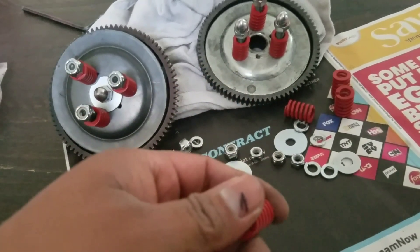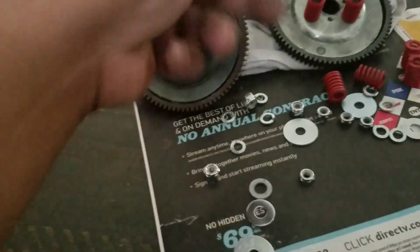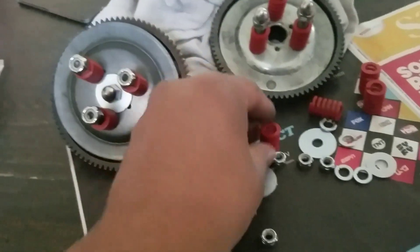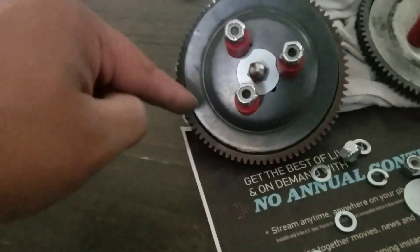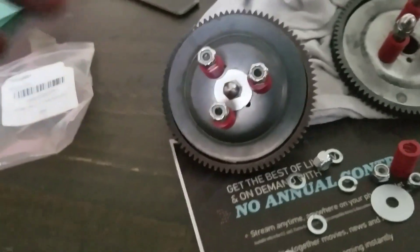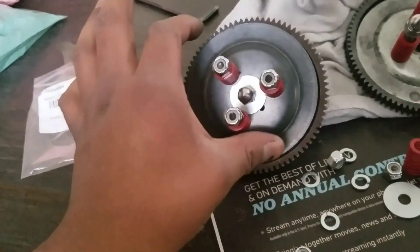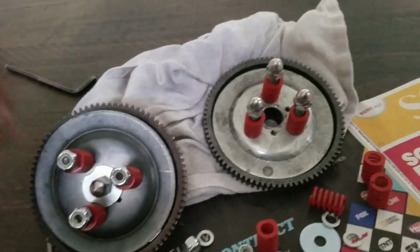Then there's a turquoise which is even stronger, and then there's brown — the brown one has a lot more torque. I think these are rated at 300 pounds, so that's 300 pounds all the way around. You could also drill more holes and instead of having three springs you could have six springs, which should grip the plate much better — you're six-cornering it instead of three.